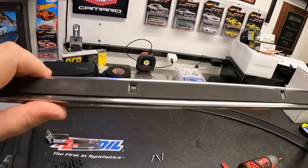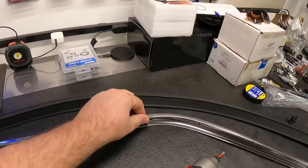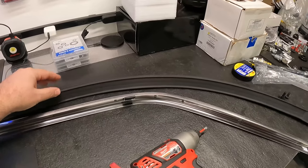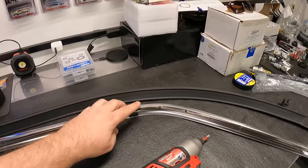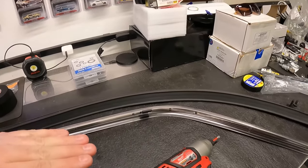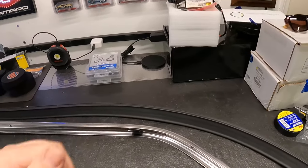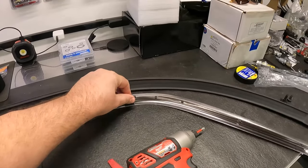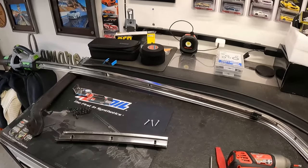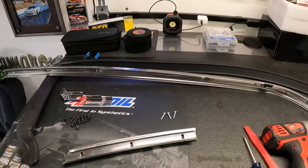You can see the rubberized foam on the top of the main rail too. The metal tabs on the other side are your top window stop — they force the window up against the weather seal. Make sure these aren't bent too far in; the ones I got from the company were bent way too far in and I couldn't close the door without pushing the upper edge of the window down, so I've bent them up and resolved that issue.